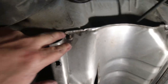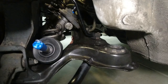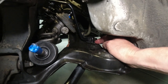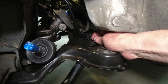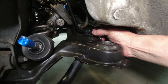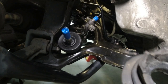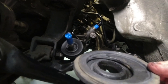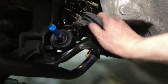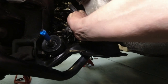Clean the heat shield, put it back in. There's two nuts. Down at the other end, two bolts. That's in. Let's go back up top. There's a hose bracket that I undid earlier as I was lowering this frame. So I'm gonna put that back in there and I'm gonna put this little 10 millimeter bolt in there. Anyway, I can't hold the camera to do that, so I will put that bolt back in. I put this on upside down. So the arrow facing front goes this way, and this is the upside because these cutouts fit around all those valves. So we can do it from down here since we got the frame lowered.